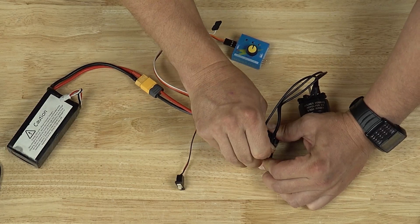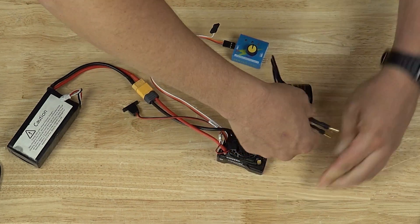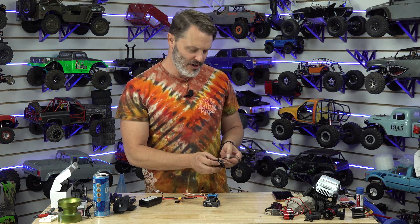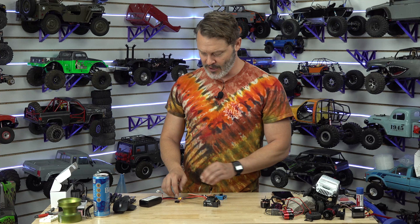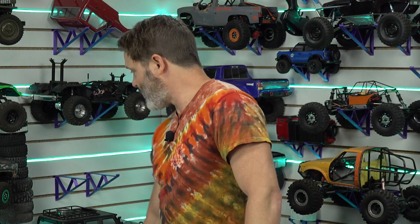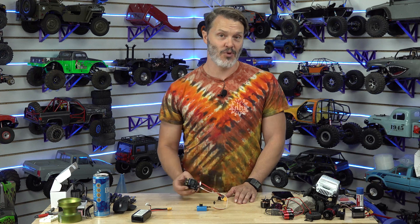The new Cobra 10 from Castle — if you know Castle's general vibe, this one's not going to be much different. That little gap between the startup frequency and the normal operating frequency you may notice in a crawler. Honestly, I've gone to other controllers for outrunners because they tend to be a little more quiet and have RPM lock at low RPMs. We will definitely go out on the rocks and I'll show you how it performs in our next video. If you want to see it installed in anything particular, let me know — probably a Vanquish rig or the Element Enduro.